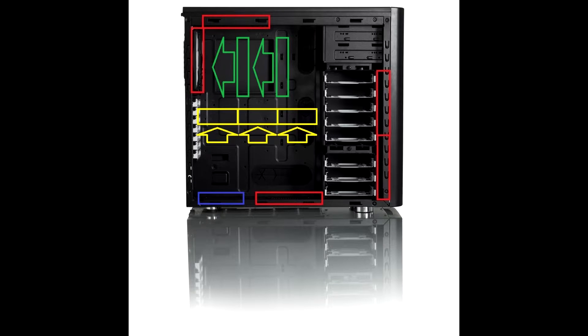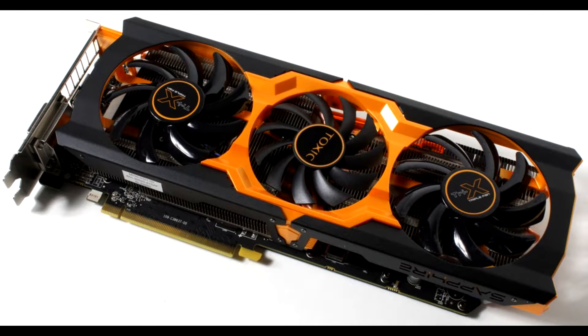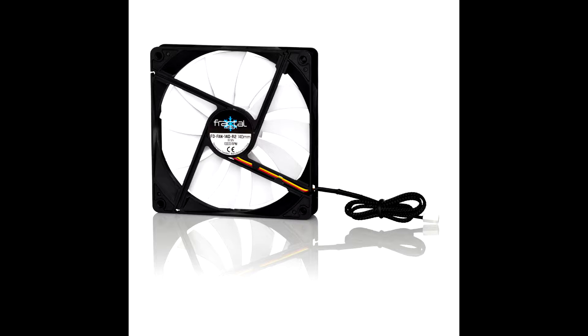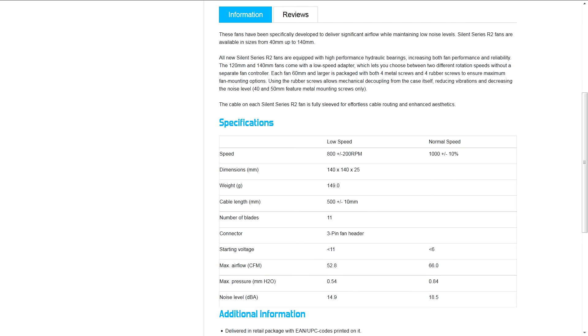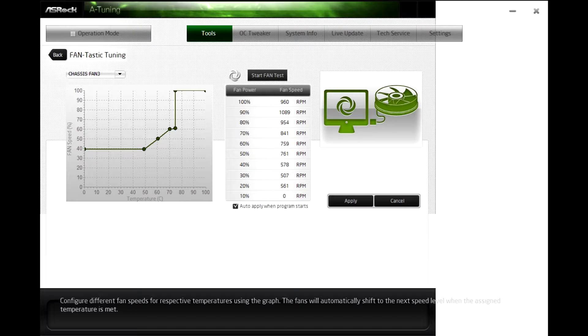All tests are made on the same system, which is actually my personal system. The specs don't really matter — the important part is how the thermals and noise change according to fan count and fan speed. All case fans are Fractal Design Silent Series R2 fans, 140mm. You can see the specifications of those fans on the screen right now. I'd like to draw your attention to the static air pressure of 0.84mm — this is at maximum speed, keep that in mind. The case itself comes with a fan controller for three fans, and the other two fans are controlled by my motherboard and its visually buggy software. I checked the fans though — it's just the visuals that are messed up. The fan control on the motherboard is working just fine.